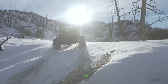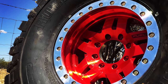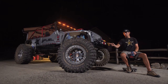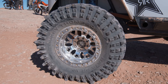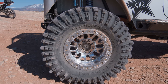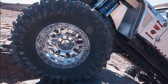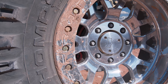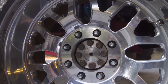It is a lot for a tire to do both well, and the tire compound is awesome. It really does handle the street — smooth and quiet — but the traction on rocks and in wet situations is by far the best wet-running tire I've ever run. I'm running Fuel wheels and have been with Fuel for three years. I was running the 17-inch Anza Beadlock — a great wheel that I beat to smithereens and they still held up. I went to a 20-inch wheel because of the 43-inch tall tire, wanting to keep sidewall proportions the same for speed. It's a full forged 20-inch beadlock that can take those hard rock impacts, and it's been performing outstanding.